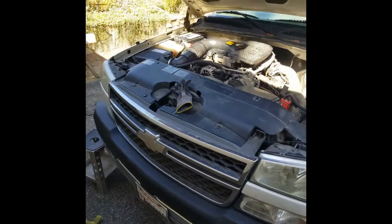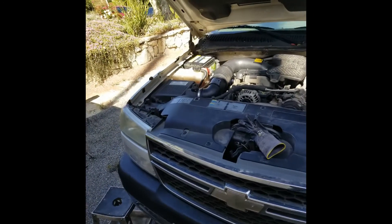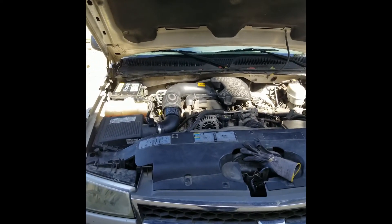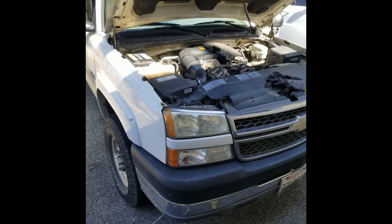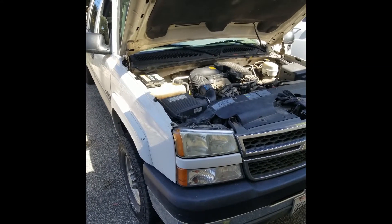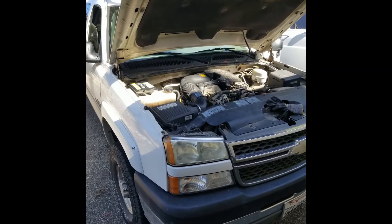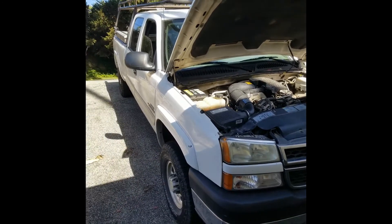But now that allows me to go in and investigate and pinpoint where I'm getting this fault and where I'm getting this shorting. I thought I'd share this since I've been going through a lot of frustrations on why this intermittently happens. I've replaced probably six of the injector connectors, but it seems like every time I replace a connector it's the wrong one. So the jiggle test, which this is, seems to be quite effective.